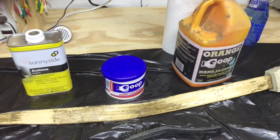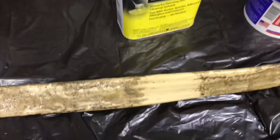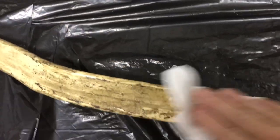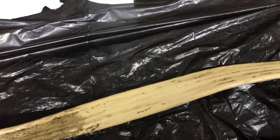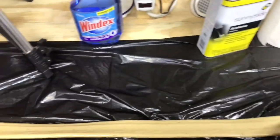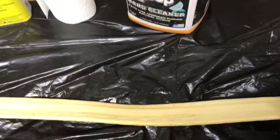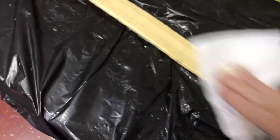I'm going to try one more thing — alcohol. Alcohol works pretty well, but acetone is definitely the best because it cuts right through the residue really easily. It still feels sticky where I used the acetone, but once I put the hand cleaner on top and clean it, it feels smooth. So probably 10 feet finished now. I kind of got a system going — using the acetone first gets about 90% of the old crud off, then going back with paper towel and hand cleaner gets a lot more of it off.